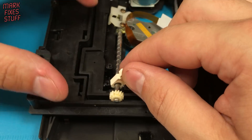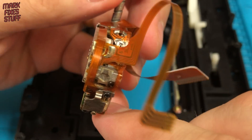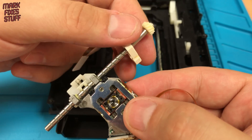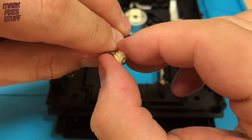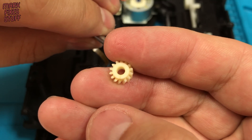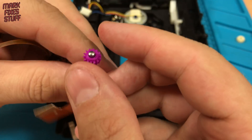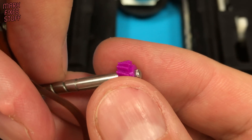The shaft needs to come out, so let's pull it off. The other side of the laser assembly simply clips onto the opposing sled rail. The drive shaft turns really easily within the laser head assembly, so that's obviously not the problem. The gear comes off easily, which it shouldn't. The splines on the shaft are meant to prevent the gear from simply rotating freely. Unfortunately, this 3D printed gear is very loose on the shaft. The pink part is gaping — hopefully resin will fill that gap.